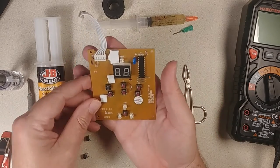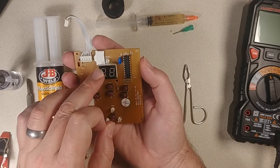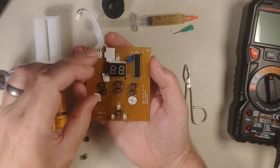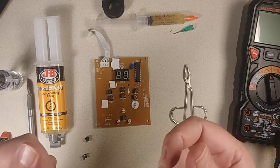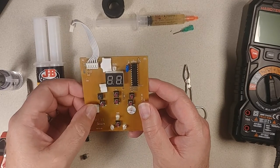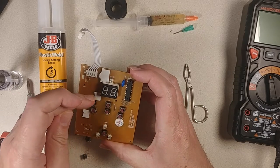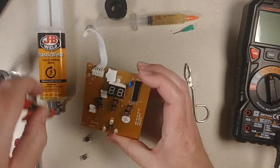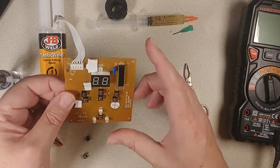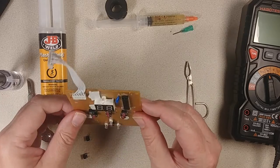Looking at the front panel side, I've attached a piece of plastic — from a Leviton RJ45 jack blank cover — across the bottom of the crack using JB Weld plastic weld. While it was drying, I had it clipped together and tried to get it pretty flat. It's not exactly flat, but that's okay — it was always getting pressure on the front anyway, and it is very rigid now. With those three pieces in place, you can't flex that crack anymore. That's how I fixed it physically.